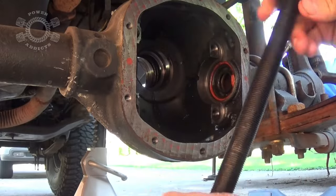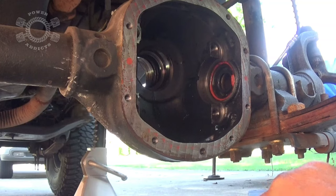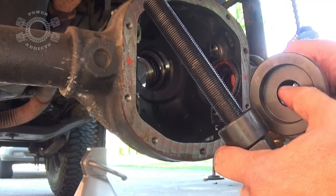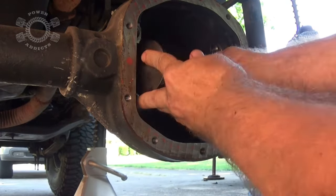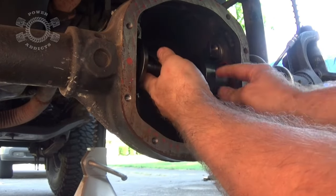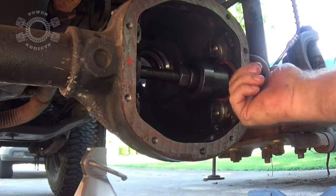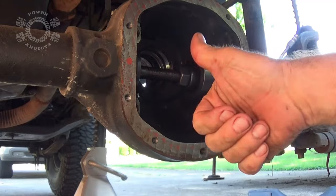They go like that right there — see that against the inside lip of that seal. From there you just start turning that nut, pushing that tool in, which will press your seal in place. Pretty easy.